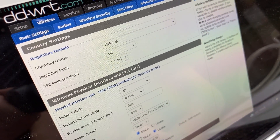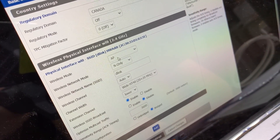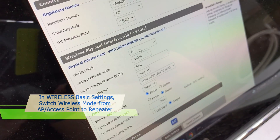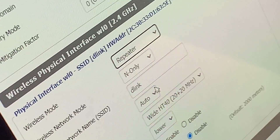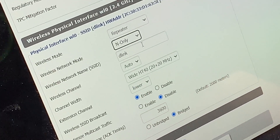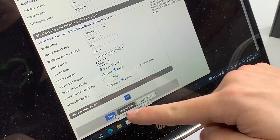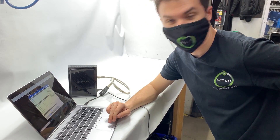So now I'll just go to Wireless, then Basic Settings. When I click down here we are in access point mode, which is just the router making its own access point. We don't want that — we want to boost the other access point we're actually using. So I'm gonna click on Access Point, then click Repeat. Then we're gonna type in the wireless network name — the SSID of our original Wi-Fi network which we want to boost. In this case it's D-Link. We're gonna save these settings, and after saving, other options will appear. Just leave it as-is and click Apply. This is easy.